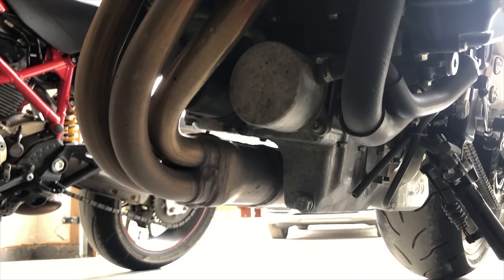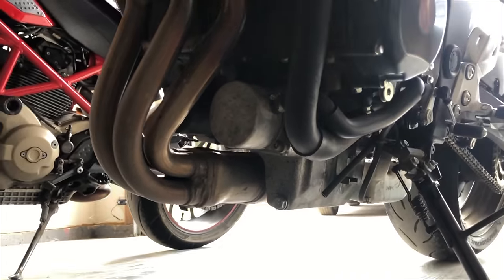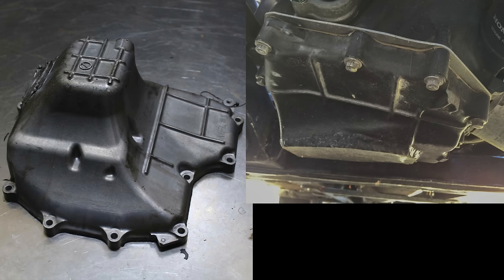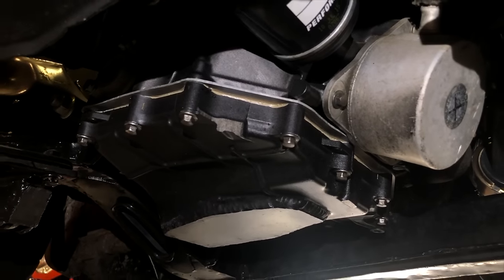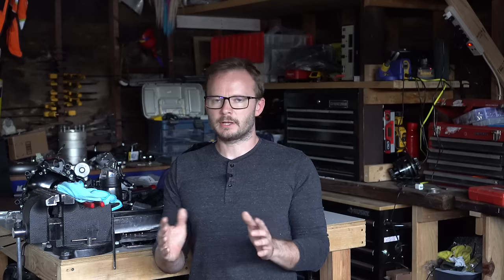You might also need to shorten the oil pan — and this actually needs to happen first. Many modern motorcycle engines have a really tall sump; this motor was maybe five inches too tall. I took the oil pan off and chopped off the sump. Make sure you measure how much you cut off because there's also a pickup in the engine that needs to be shortened by the same amount. On some engines you can buy an aftermarket dry sump system — the Hayabusa has this — and if you like buying aftermarket solutions, the Hayabusa has a huge aftermarket. I also added a baffle between the engine and the pan to keep oil from sloshing away from the pickup under lateral acceleration.